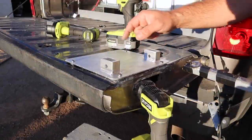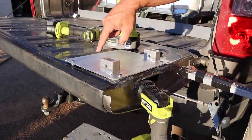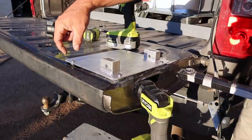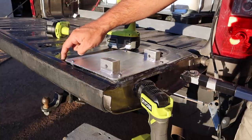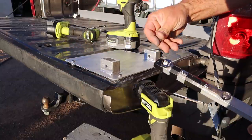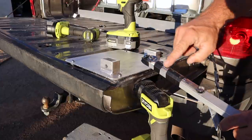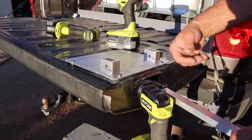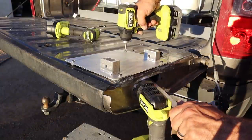Right now I'm trying to secure this plate to the tailgate. I pre-drilled all my holes and I've got some stainless steel machine screws with stainless steel washers — that way this aluminum doesn't interact with the steel of the truck bed. To get access with my little lock nuts, I simply taped a wrench on this little piece of scrap tubing and insert it in there to line it up.